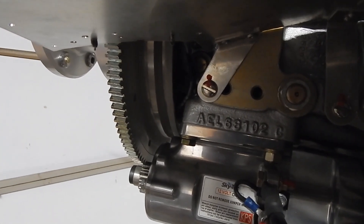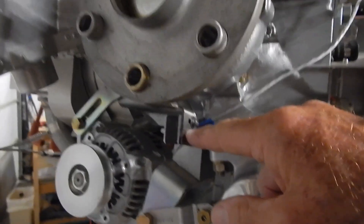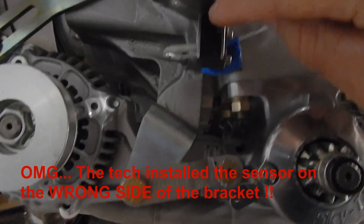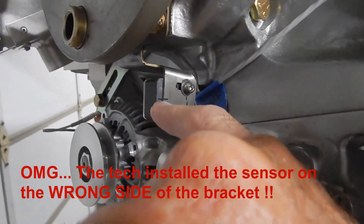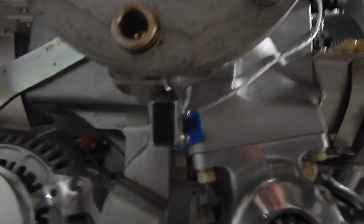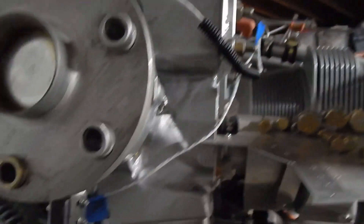Oh my god, I finally got it! What ended up happening is the bracket had to get bent and repositioned. There's a center line at the top of the sensor that's supposed to line up with the center line of the casing, and the line on the sensor is also supposed to align with the flywheel line and the casing line — and it wasn't lined up. Believe it or not, that was enough to throw it all off. The directions do say to make sure both are lined up. I lined it up, reinstalled it, and it's working. Now I just need to get my wires sorted and baffling back on.